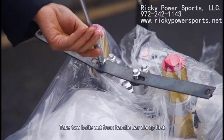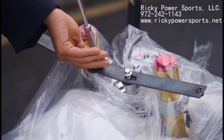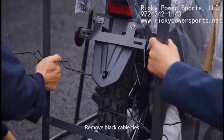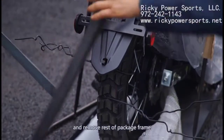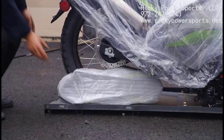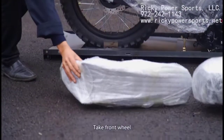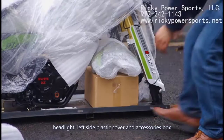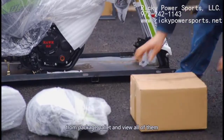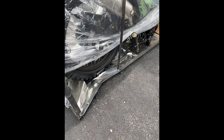Still using a 10 millimeter socket, take out the two bolts from the handlebar clamp. The steel package frame at the back wheel is held in place with two bolts at the bottom on each side, and you can continue removing the rest of the package frame. Don't worry, the bike won't fall over. There are lots of wrapped up accessories like the headlight, plastic covers, and accessories box that you'll want to remove from the frame area and inspect for any damage. My steel package frame was horribly bent up. I thought for sure I'd find some serious dents or things broken, but surprisingly, just one small little reflector was the only casualty on my bike.